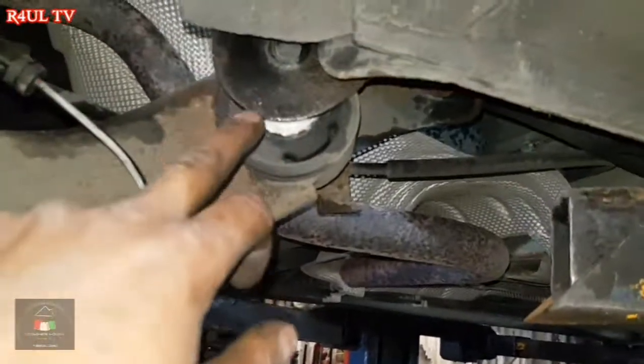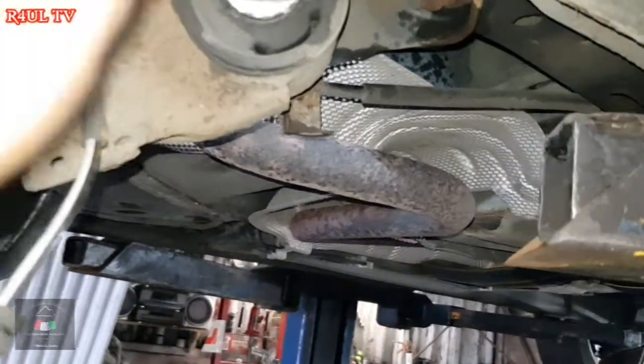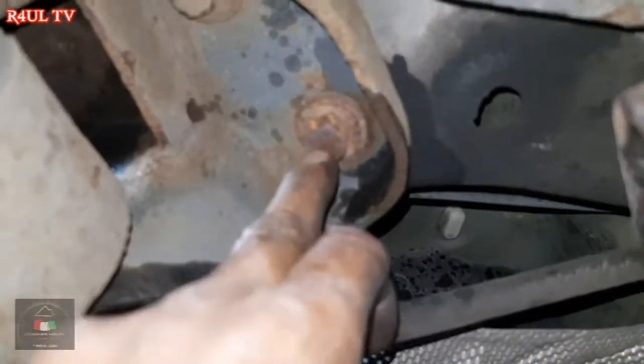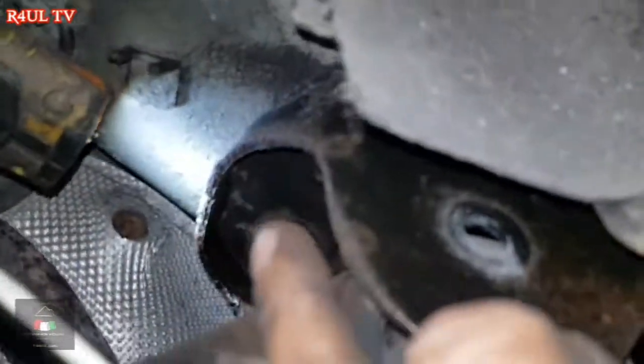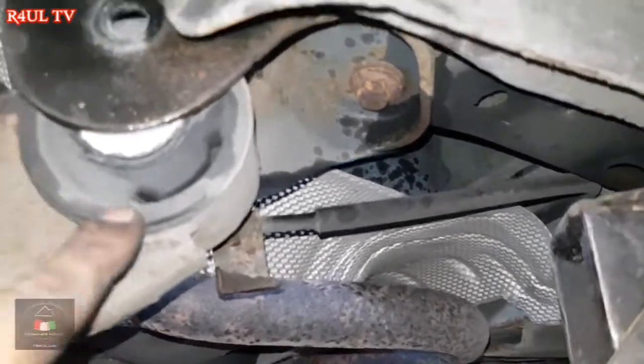It's come down — that's more than enough because we can change the bush there with the tool. This bracket — we slackened the bolts, these 15 mil ones, one, two and three. We need to take them off and hopefully that will be out of the way so we can get to that bush. This is the culprit here.